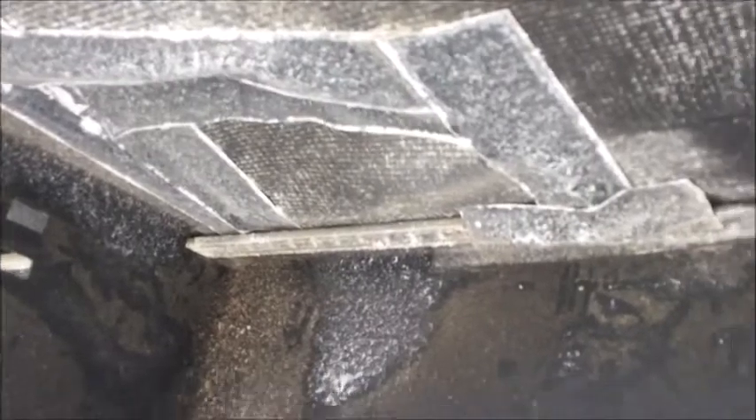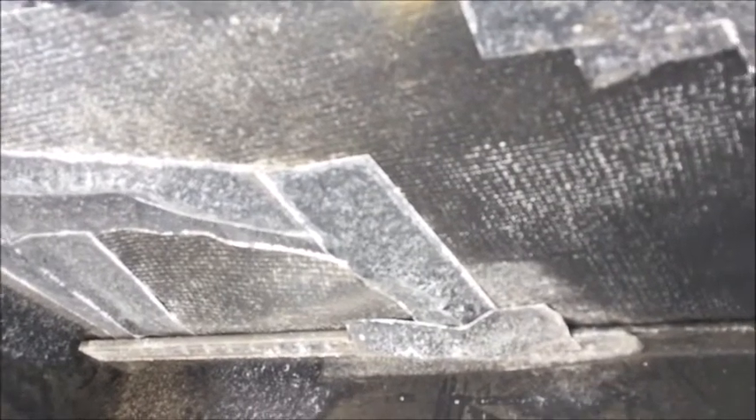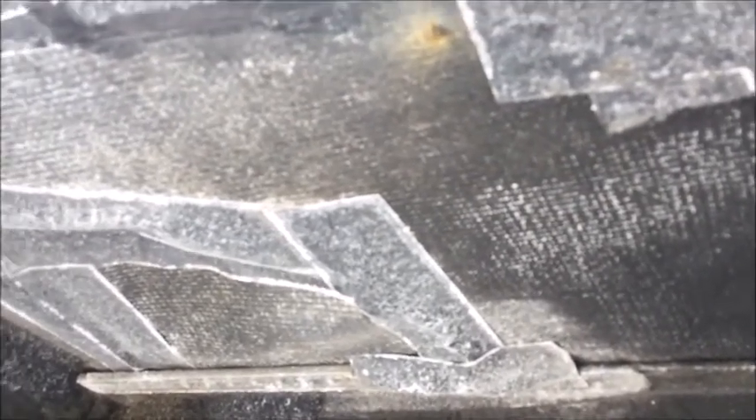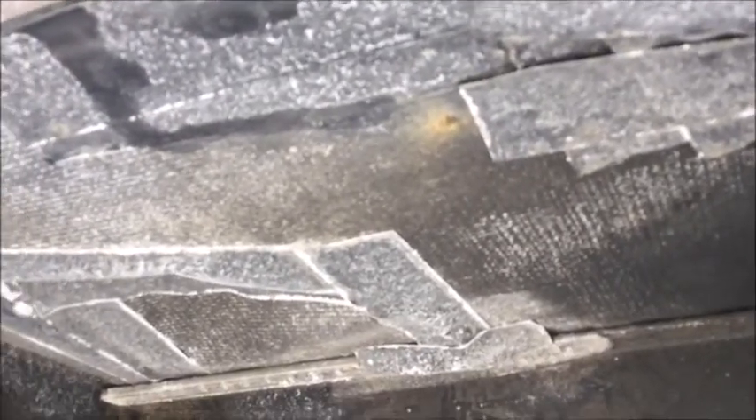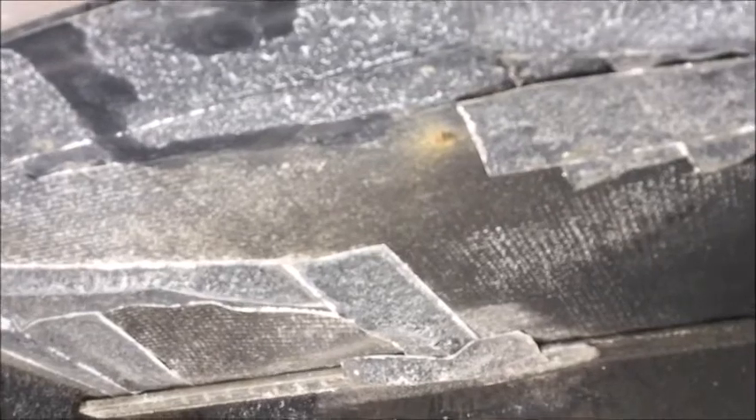There is an LED light strip under this camper. One of those quick connectors came undone about a week into our trip, so I had to wire it back together the old-fashioned way and tape it up. I went around the whole camper and found more spots where the underbelly wasn't taped well. We also had mice come into the camper just three days into our trip. I've sealed everything off better and we haven't had any mice since. You might want to crawl under your camper when you get it and tape up everything better than it comes from the factory.